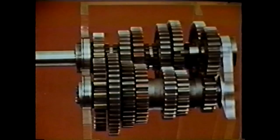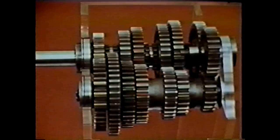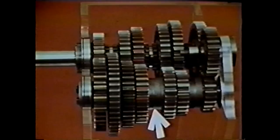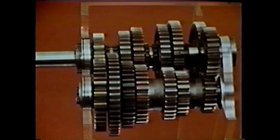All mechanical transmissions incorporate the same basic components: an input shaft to deliver engine power; a counter shaft turned by the input shaft, containing a series of gears to drive the main shaft; the main shaft itself, on which are mounted matching gears driven by the counter shaft gears to provide a selection of gear reductions; and a reverse idler shaft, which permits introducing another gear into the gear train so the main shaft direction of rotation can be reversed to run the vehicle backwards.